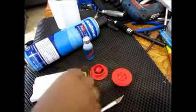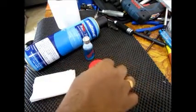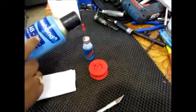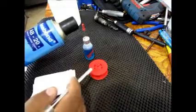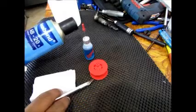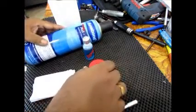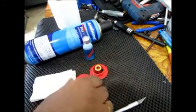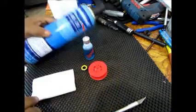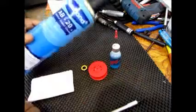You open it up, place the bearing on top of this, close it, and use the nozzle that comes along with the contact cleaner and spray as hard as you can. It'll drop out all the dirt and the grease to the bottom. It's not a required item, but it's always nice to have, because the electrical contact cleaner is pressurized, and you're likely to have some very cold fingers after you use this item.